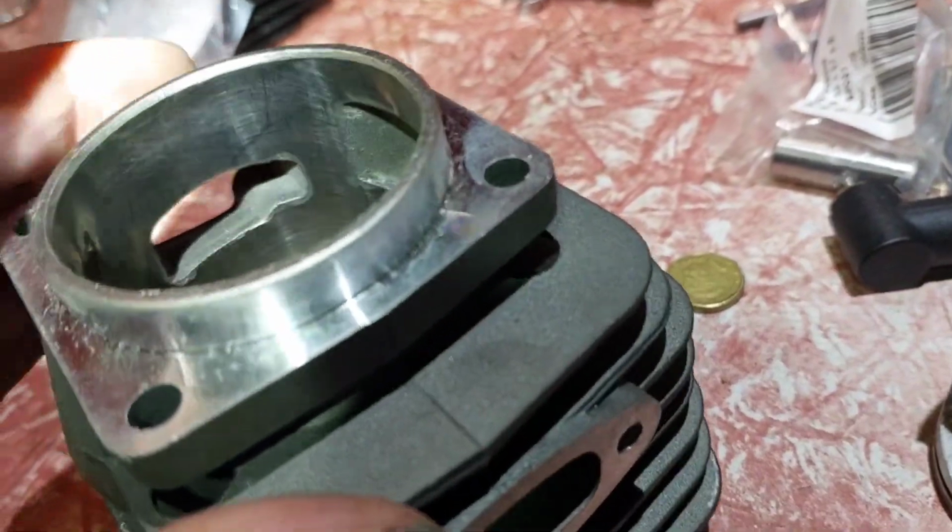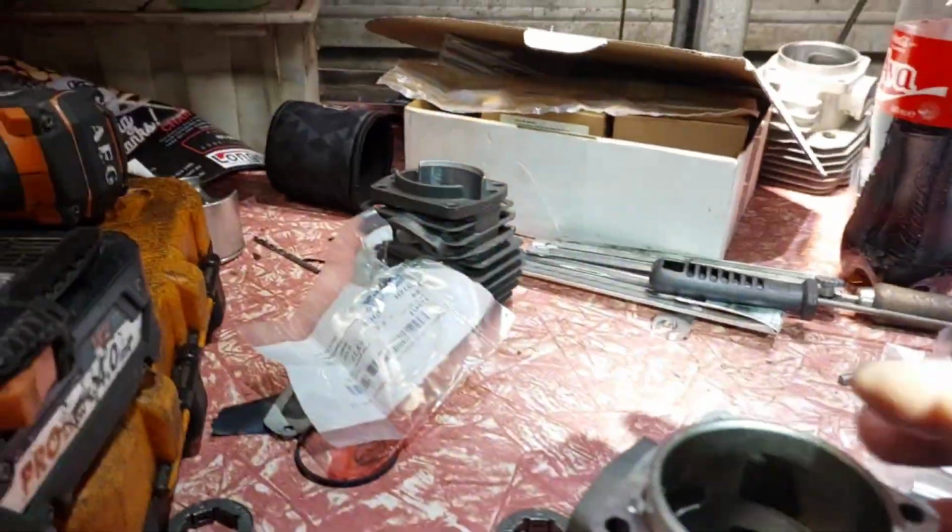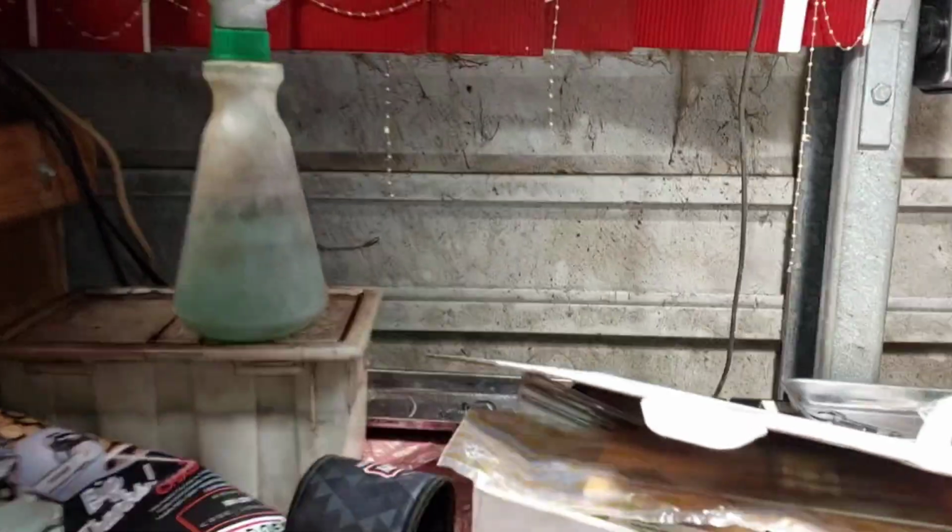On the boost port to open up midway. That way, when the upper transfers open up first, they come up, release most of the pressure, flow out the exhaust hole, the majority of it, and halfway through that, the boost ports open up too, and we're worried about the boost ports going out straight to the exhaust because it's pointing that way. So I want the leftover of the transfer, the last part of the transfer, to blow that upper transfer back in with the boost ports. So the boost ports will fire into the last piece of the transfer.